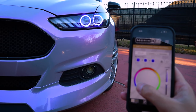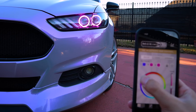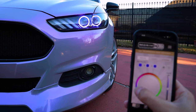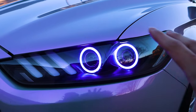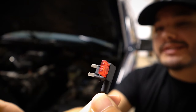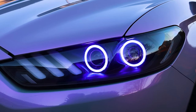You can control them from your phone. The app is a little dated, but these have a black housing with a clear lens, giving you that nice sleek look. These gills can also function as running lights — there's a blue wire that comes with them. All you have to do is a fuse tap to an accessory fuse and you're good to go. I've done a ton of videos on fuse taps if you want to look at those.